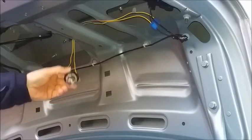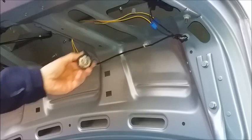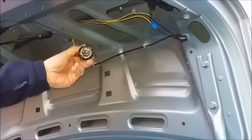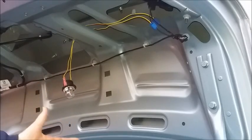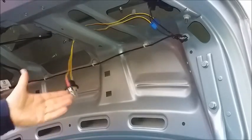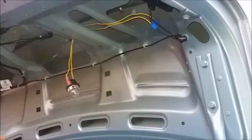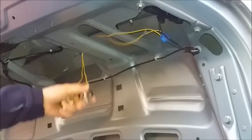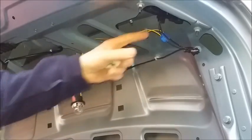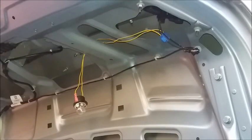You can see here that what I've actually used as a resistor across the LED bulb is an ordinary bulb in an old holder. That's what the ECU is looking for — it's looking for a bulb in place. So use a bulb as a resistor. As you saw, even with a resistor — in this case a bulb — connected across the bulb holder, the LED still flashes.